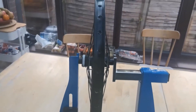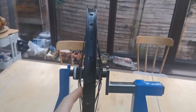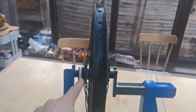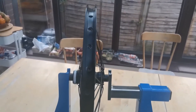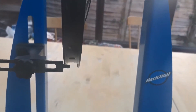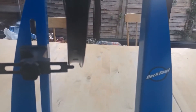The difficulty was — which you can probably see from here — the spokes on this side are much tighter than the ones on this side, and that's to cope with the fact that this has got a disc brake mount there. So it took absolutely loads of dishing, but it is now true to within, I reckon, half a millimetre or something like that — a millimetre on both.